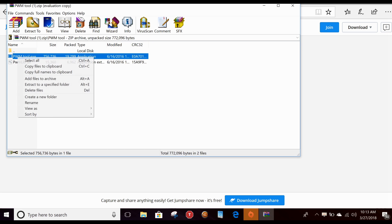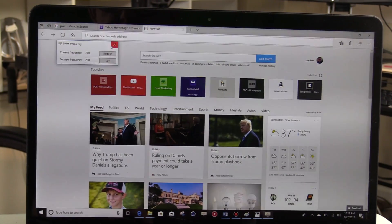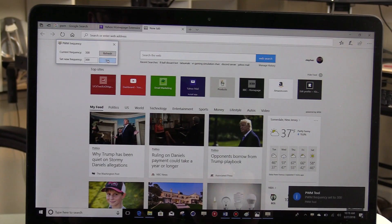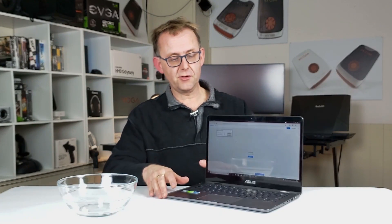Right-click on it and set the PWM tool frequency. At a frequency of 200 you can see the flicker, but change it to 300 and the flicker goes away. That's pretty useful — use it at your own risk. I wouldn't recommend going too high; one viewer set it at 600, but set it to the bare minimum that works. Thanks for watching — thumbs up, subscribe, and thanks again Allison. Congratulations, bye!